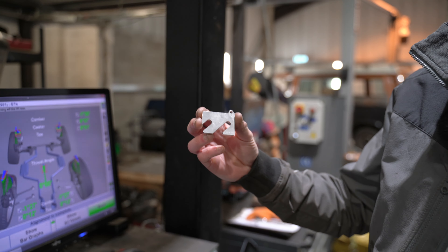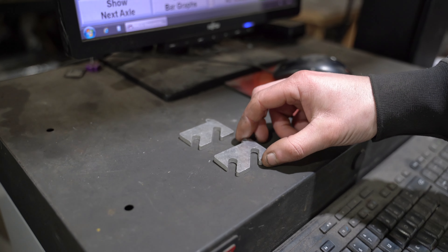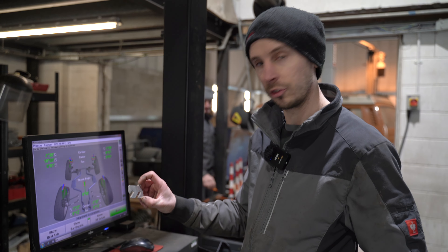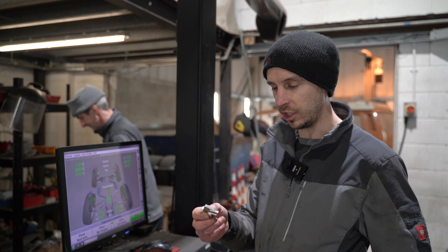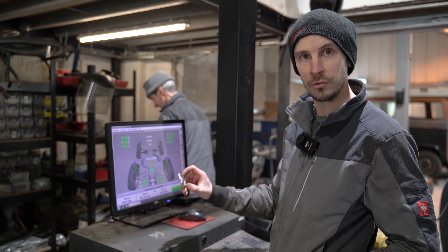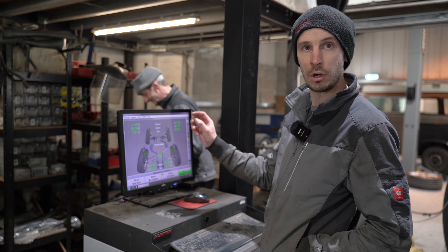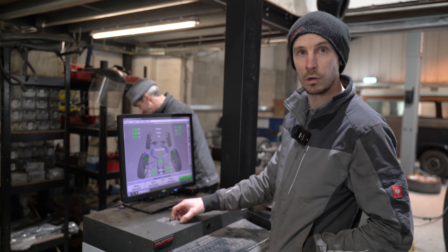Ordinarily we would put shims in the lower arms to make the front of the car wider, and for people that want more camber where the top mount is constrained, this will get more negative camber. It's a motorsport part — you can buy these from Porsche. The GT3s and the RSs use these a lot, but we've used them here for an alternative purpose: to give more stability and a wider front track, then used the top mount to trim and pull the wheels back out. The front of your car is now 10mm wider than when it arrived.